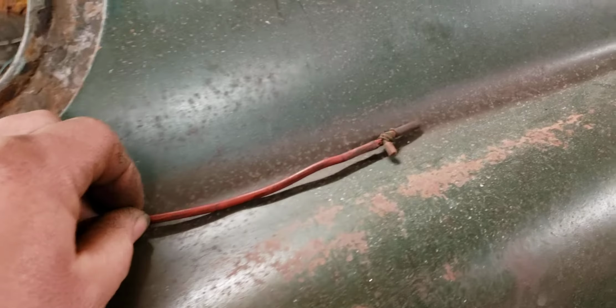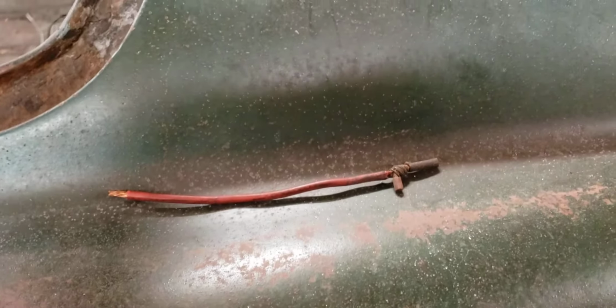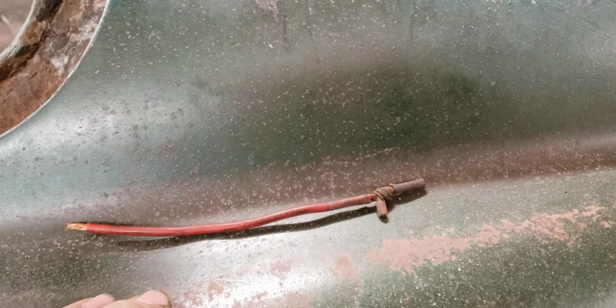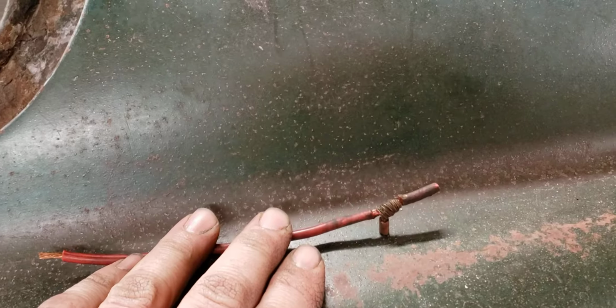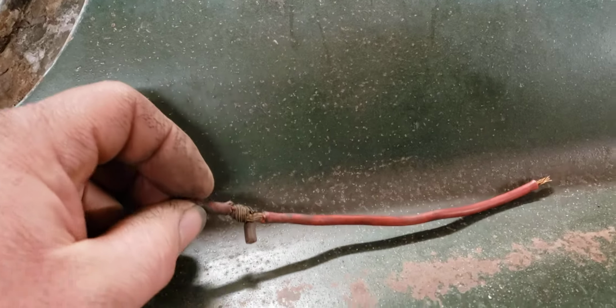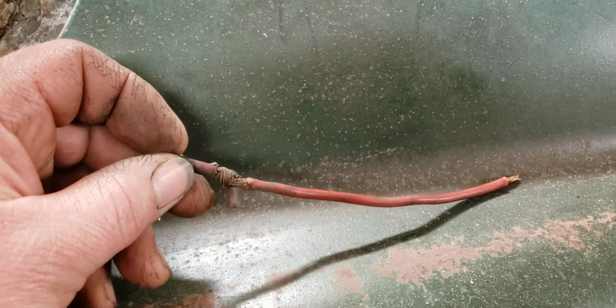Yes. This one is my all-time favorite. And this did come out of this car about 4 years ago. That's my buddy's car. He bought it this way. He didn't do it this way. But the car kept dying on him. Just shut off. Let it sit for a little bit, start back up, and he'd drive again. So I came down to this place and we're looking it over, and the car starts right up, no problem. I started pulling on the harness and it died.